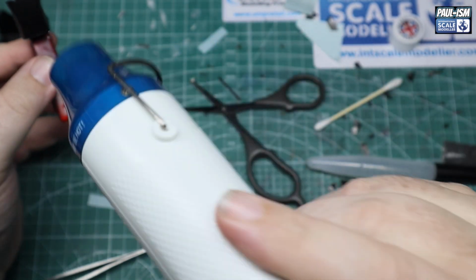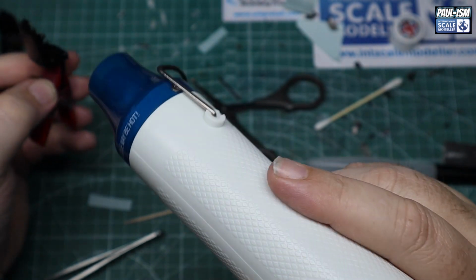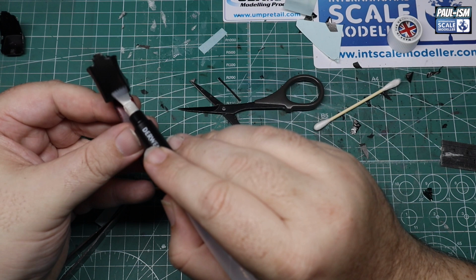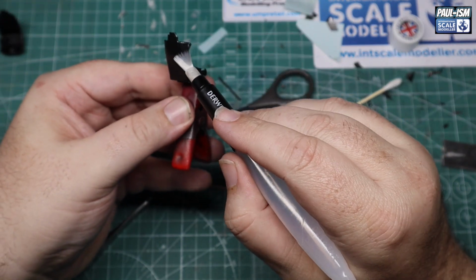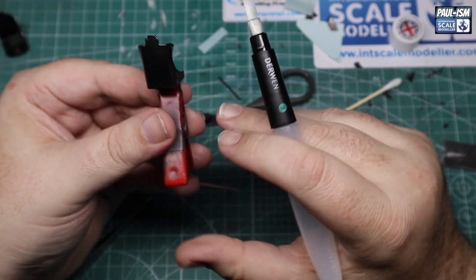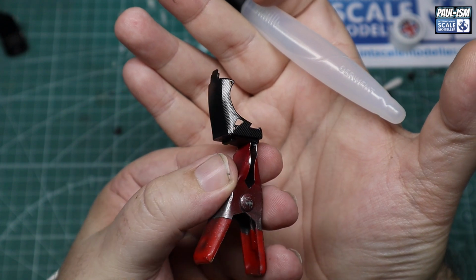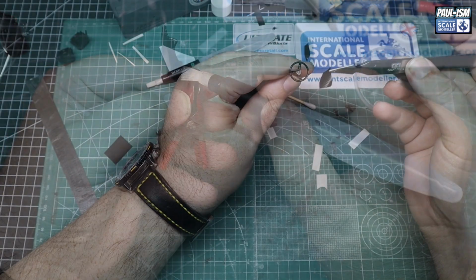And on the back, like I say, I've pieced it, so we've got a straight piece right down the middle, and then if we pop the weave on to the existing piece, line it up, it will kind of melt in and you won't really see it at all. Like I said, with that line up the middle being straight, hit it with some heat, some decal solutions. We can then match it on the other side with an opposing piece. So as you can see, we get like a chevron pattern. And we get a pretty flawless carbon seat. Look, not too bad at all, even though it is a slightly different colour. I'm happy with that. That'll do me. So we'll just repeat that on the other seat, and we're good to go there.